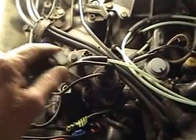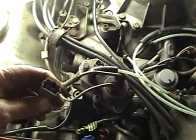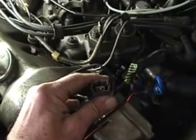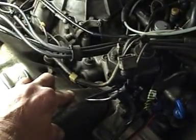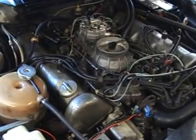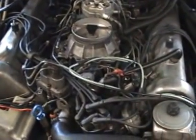The next thing I was going to look at is this warm-up compensator. It says check the voltage from the plug here — you should get 12 volts with the engine running. And guess what, I didn't get 12 volts. So now I've got to go and study the wiring diagrams and see where this feeds from, then I'll come back again. This is a bummer. It's supplied from terminal 3 of the fuel pump relay, and terminal 3 also supplies the actual fuel pump — and we know that's working. I changed the fuel pump relay but the old one had nothing wrong with it.